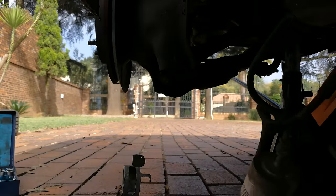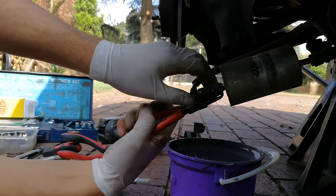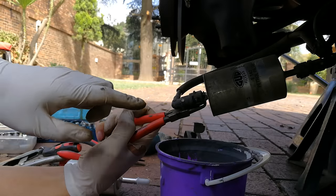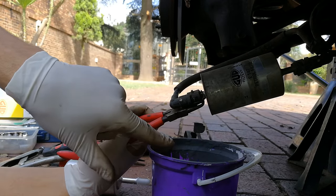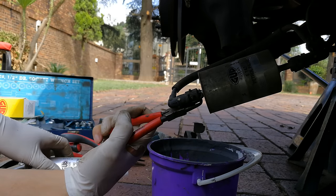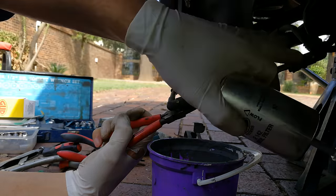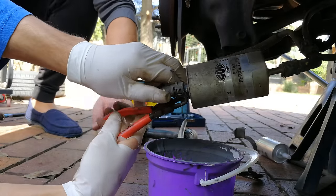When I release this it's going to have petrol flowing out, so I'm going to get a little bucket. I recommend taking the outflow one first, and it will drip into the bucket. Then get someone to hold it with their finger while I fix this pipe onto the new filter — and then do the other side.